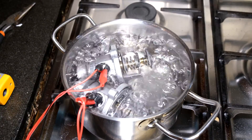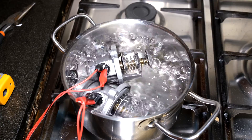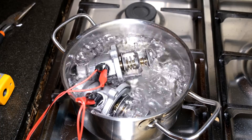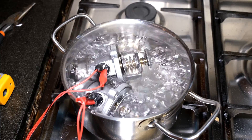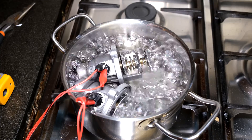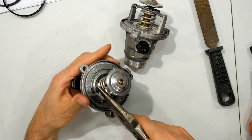What I did is provide them with an additional supply — that would be the MAP function — and what it's doing is heating up that cavity through the electrode. That's why they're both opening. They open pretty much the same, even though one was advertised at 95 degrees. They also opened the same amount. The one difference was that one opened earlier, and believe it or not it was actually the OEM one that opened earlier.